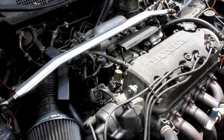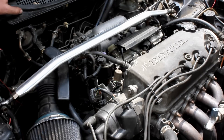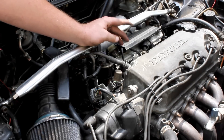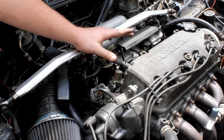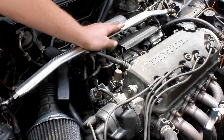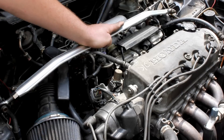So what is VTEC? What does it do? What does the VTEC solenoid do? I'm going to answer this very briefly, because I'm actually going to make a video entitled 'What is VTEC?' that'll go over the three different kinds of VTEC in depth. Basically, VTEC stands for Valve Timing Electronically Controlled. There's a VTEC solenoid which monitors the oil pressure, and when oil pressure builds up to the certain point it needs to be, the solenoid is going to activate the higher profile lobes on your camshaft, which is going to control your valves more aggressively — and that's how you get that extra little boost, more fuel, and that cool little sound.